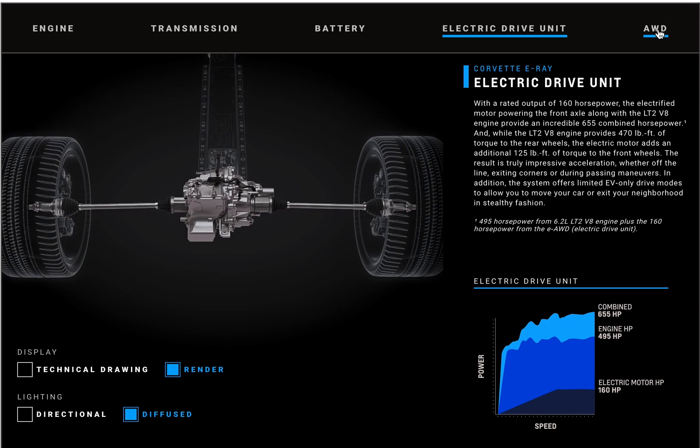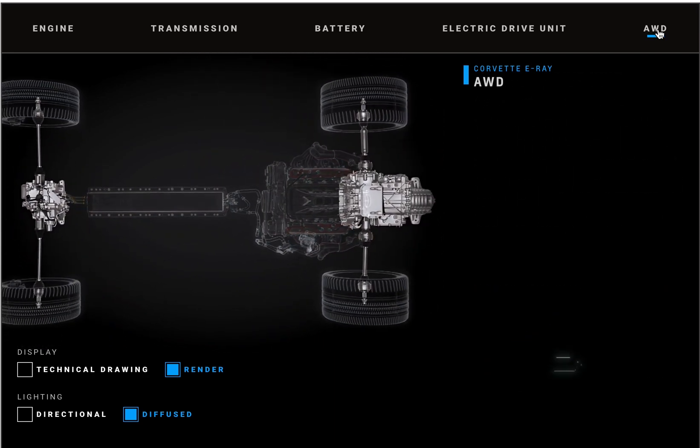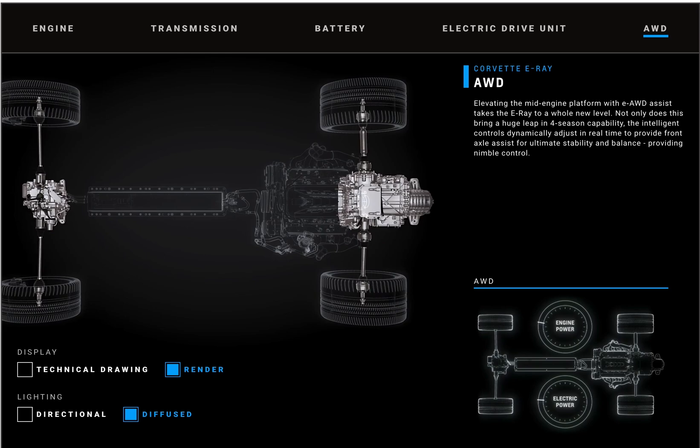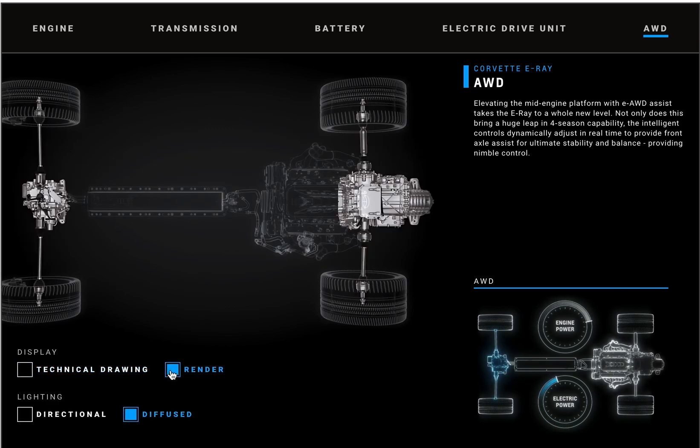The x-axis on that chart is vehicle speed, since that relates the motor RPM with the engine RPM — they're not mechanically connected. The all-wheel drive system is totally independent: the electric drive unit in the front is powered by the battery pack, while the internal combustion engine sends torque to the eight-speed at the back. You can see how the engine and electric motor combine during acceleration, and how the electric motor provides regenerative power to recharge the battery pack during deceleration.